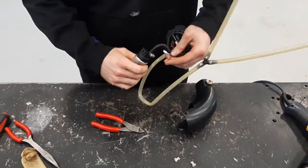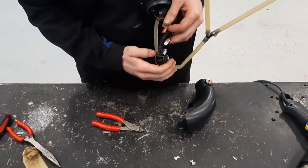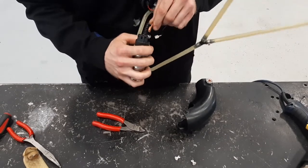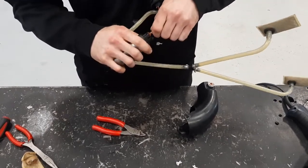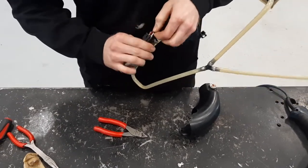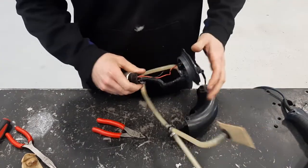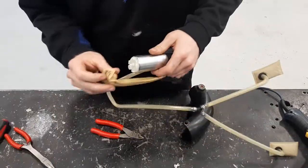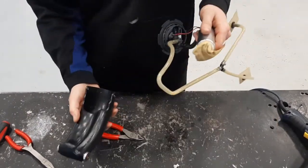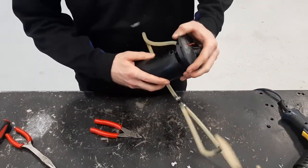The terminals will be reinstalled. There is an indicator on the pump for which side positive and negative go to. The sock fits on the new pump and then you're going to reinstall it into the canister and finish your reassembly.